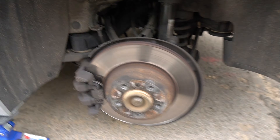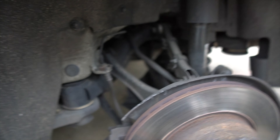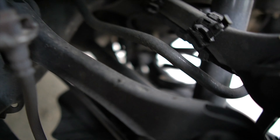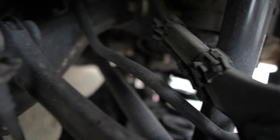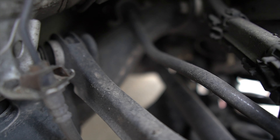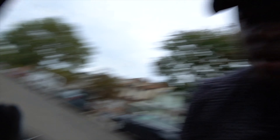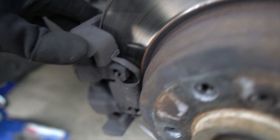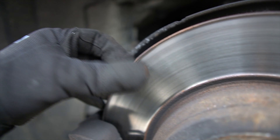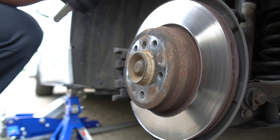You gotta take a look in here — you can see it's pretty filthy. I'm getting a slight clinging sound, let's see what that is. Looks good back here. As long as that diff stays where it needs to be and the wheel stays on tight, I think I'm good to go. But we're gonna be changing the brakes. Look at the brake pads — yeah, they're pretty much shot, and the rotor has a real pronounced lip on it. So I'm gonna go ahead and change it. Got my H8 with my half-inch socket.